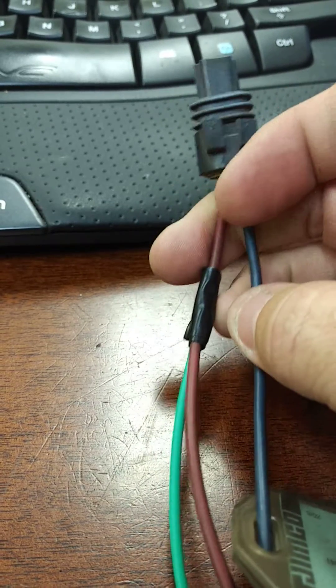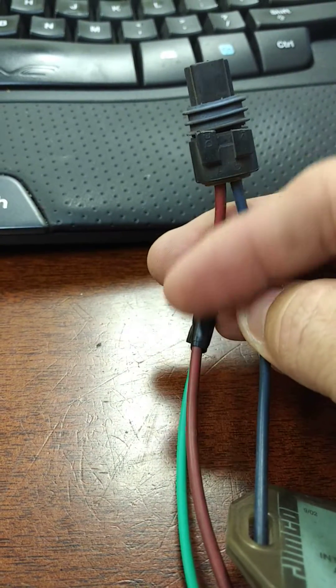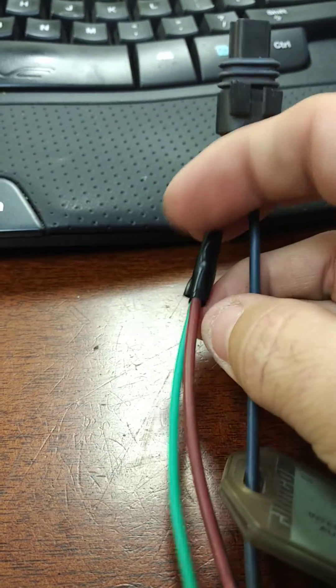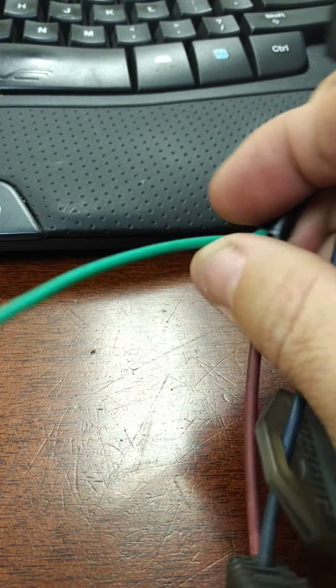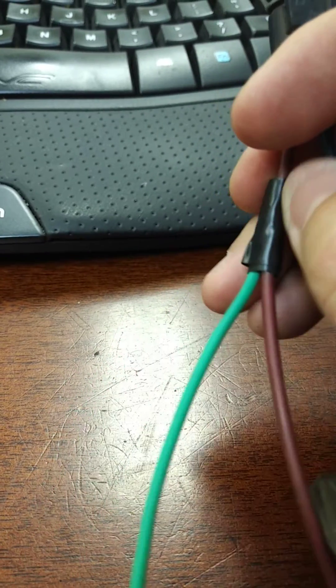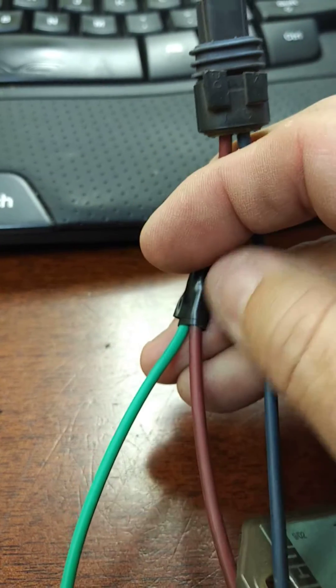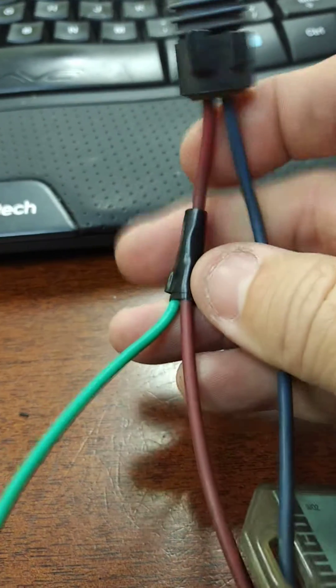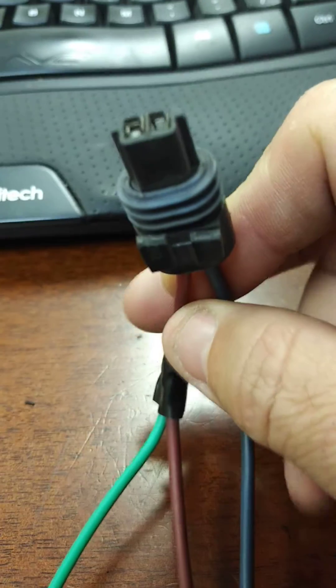When this isn't plugged in and it's still just dangling in your car, the wire that's to the left of where your locking tab is — you're just going to go ahead and tap in another wire onto the existing wire loom here without cutting it off completely, and connect this wire onto your alternator's positive post. That'll go ahead and turn your light off.